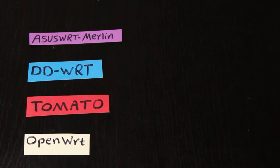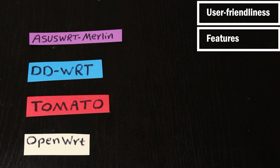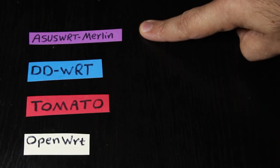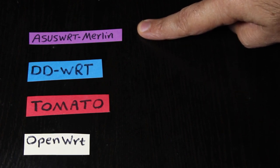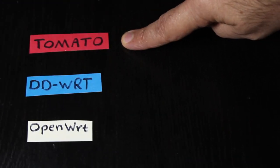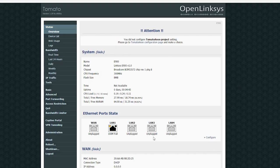At this point I pretty much know which firmware I can install and which I cannot. Next I'll consider user-friendliness and the availability of features I need to make a final decision. ASUS WRT Merlin is designed for a number of ASUS routers only, with a special emphasis on tweaks and fixes rather than radical changes. Tomato is a custom firmware originally released in 2006 to provide extra features and more control for wireless routers powered by Broadcom processors, and it has a very user-friendly graphical interface which is quite easy to configure.